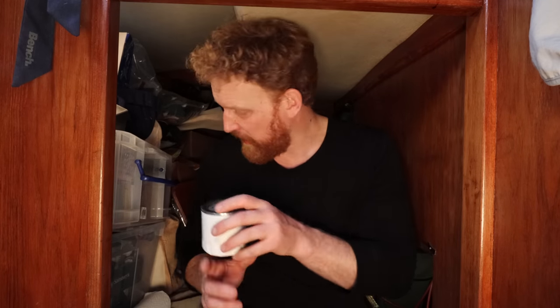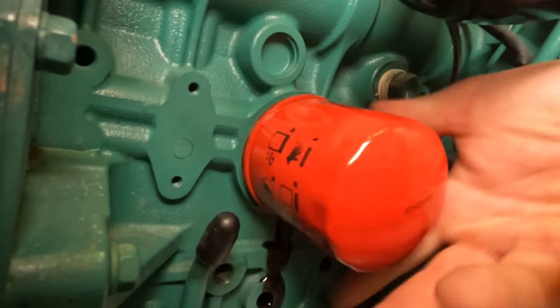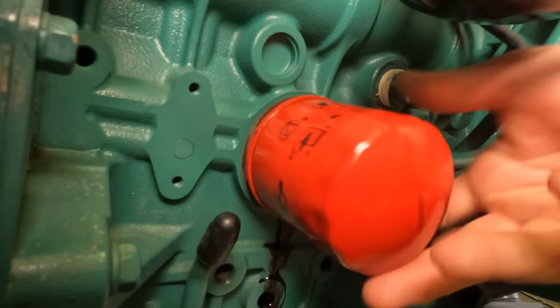It's just how snug it is back here. The first thing I'm actually going to do is remove the old oil filter — this is the new one, I'm not going to put it on just yet. I did put the old one on only hand tight, but every time I try and get it back off it's always a lot stiffer than it is to put on. So I've got myself a ratchet strap to get the old one off. There's going to be some oil spillage — trying to get it off as quick as I can.